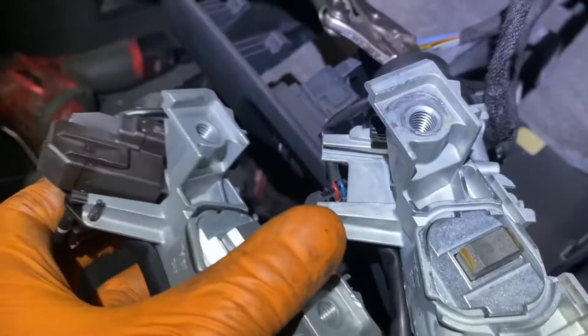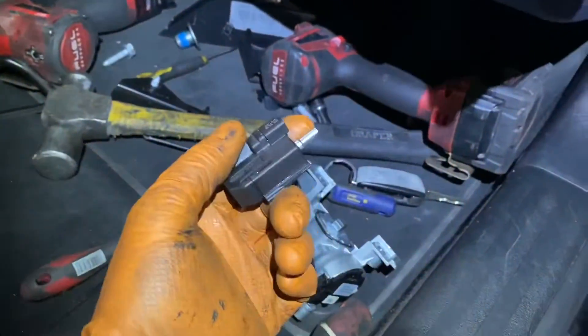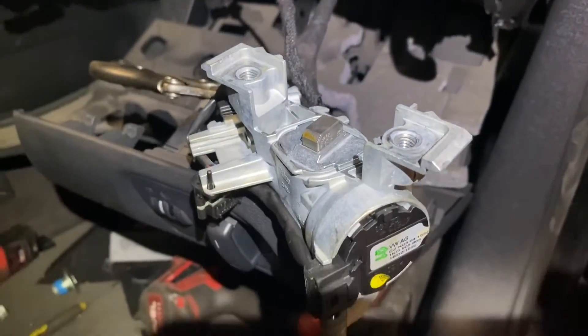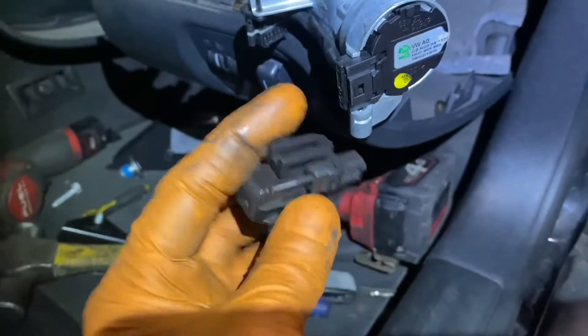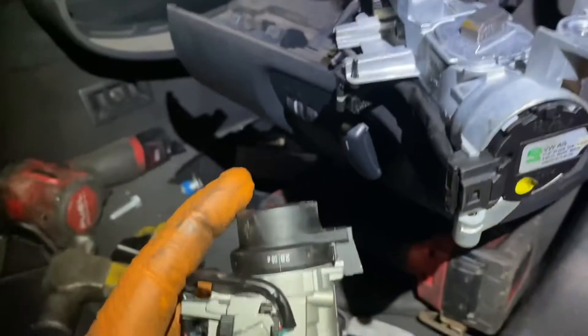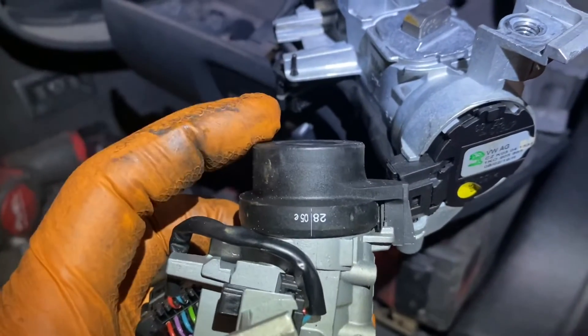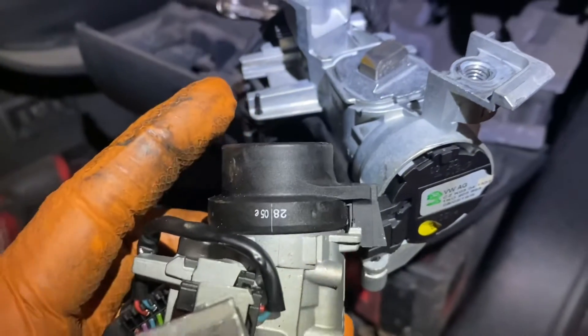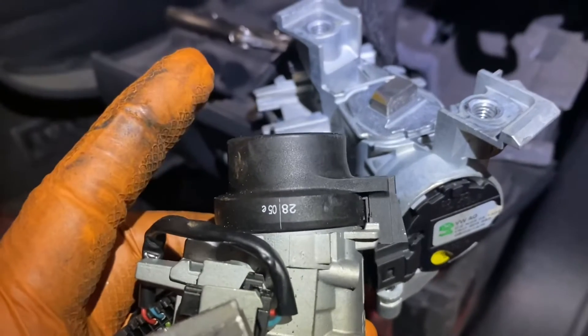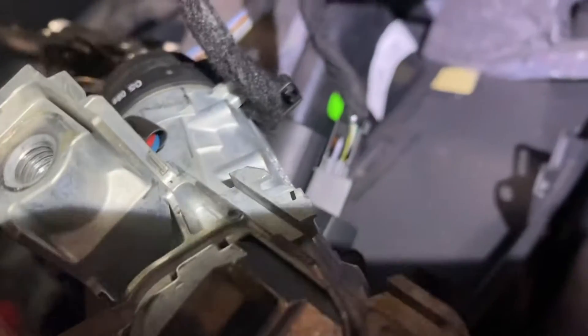There's some component or seal on the old switch that's not on the new one — not sure what it is, never seen that before, so I'll run without it. The only other thing connected is wiring coming down onto the antenna or aerial for the immobilizer. That's generic — it's not coded or tied into the immobilizer specifically. It just needs to be electrified to send an electromagnetic signal out to the key and get a signal back from the immobilizer chip. I'll unplug these wires here and plug them into the new switch.